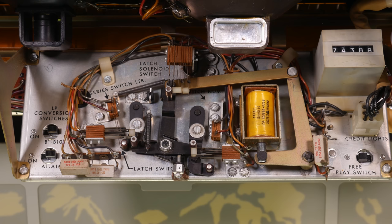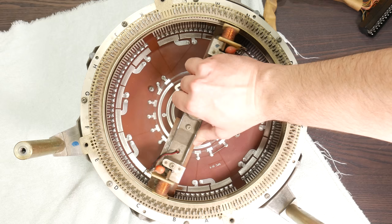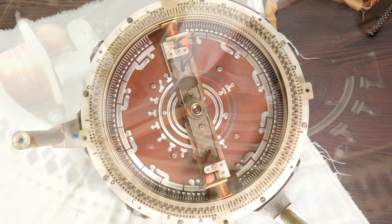on the solenoid. So now we've established that the inner contact rings of the selection accumulator will ensure it always makes a complete cycle, and the outer contact rings can do various things simply because of the fact that the physical location of the feelers riding below the armature changes as the armature spins around.